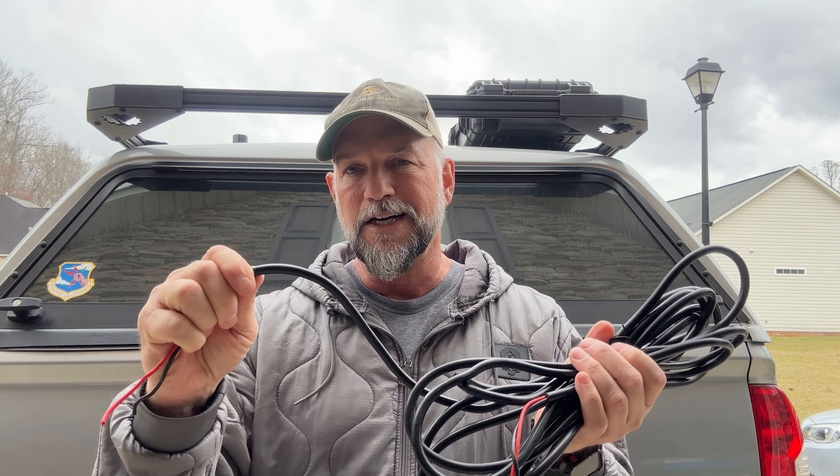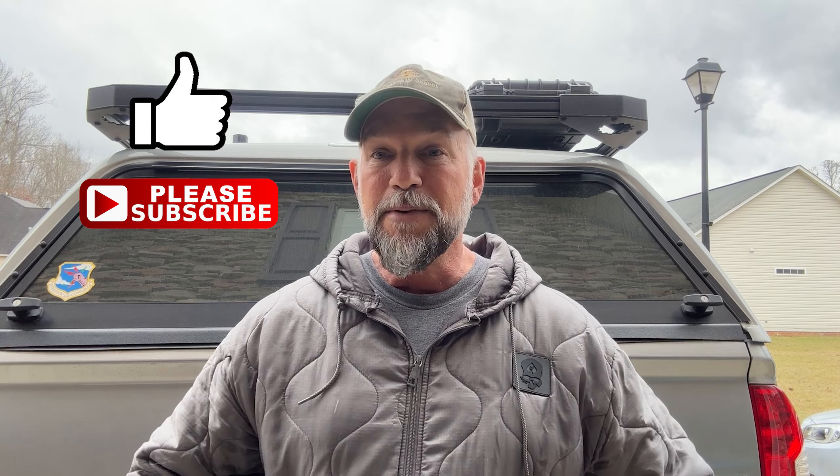I hope you liked my video on how I did the wiring of the lights in the truck, and I hope any of the tips and tricks I mentioned will help you out. It was really easy with the Garmin power switch — I didn't have to drill through the firewall or go through a grommet or any of that. That's why I liked it. Remember that insulated trailer wire — it makes things so much easier than having a couple of loose wires to tape up and zip tie. It's just one big thick insulated one and it works great. If you liked this video, please subscribe, hit the thumbs up, and comment — especially let me know about better ways to ground those wires. I'll see you next time.